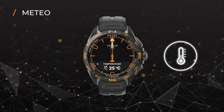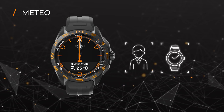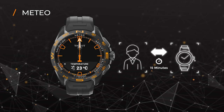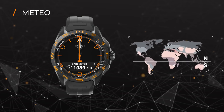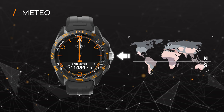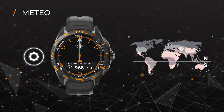In order to display the actual ambient temperature, the watch must be removed from your wrist for around 15 minutes until it's no longer affected by your body's temperature. To obtain the most accurate barometer readings, you can adjust the hemisphere and climatic zone based on your geographical location in the settings of the watch.